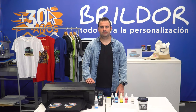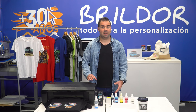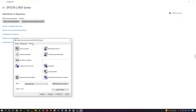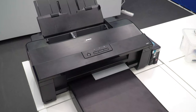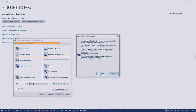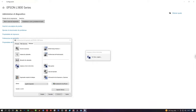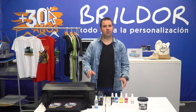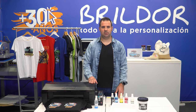Print Head Cleaning: before printing, run a simple print head cleaning. If you normally use a printer, this will be enough. Go to Print Preferences, then Utility, and click on Head Cleaning. Do a nozzle check to make sure all the colors are coming up correctly. Power Cleaning: if you do not see improvement after the head cleaning, you should run a power cleaning. This cleaning will completely empty the ink kit and the dampers and refill them by releasing pressure and unplugging the nozzles.